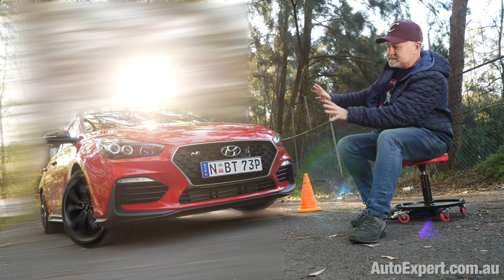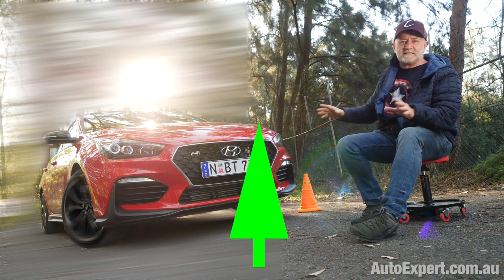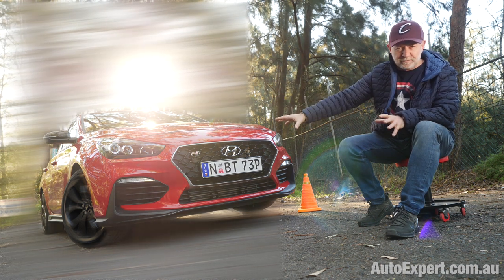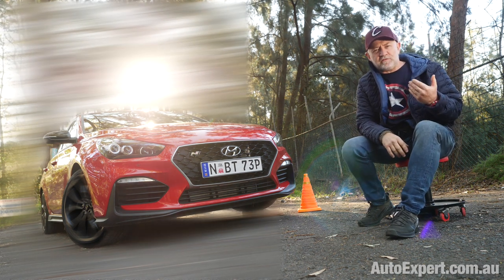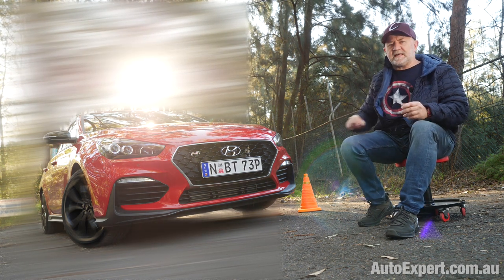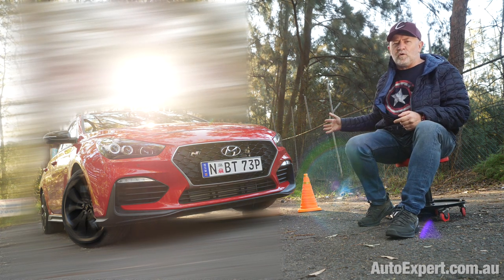As the car starts to accelerate around the bend, it rolls. There's more weight on this wheel than there is on this wheel. It's that simple. That means the right-hand wheel of the car has more traction because it's got more weight than the left-hand wheel. And if you get over-enthusiastic on the whole accelerating out of the bend thing, the inside wheel is going to spin, and that's bad because once that wheel starts to spin, it will drop all drive to the right wheel.